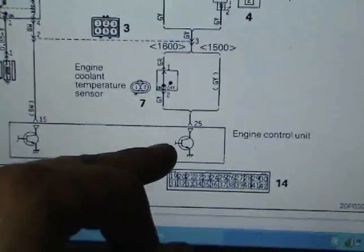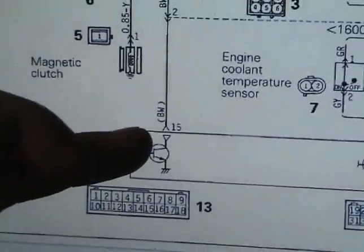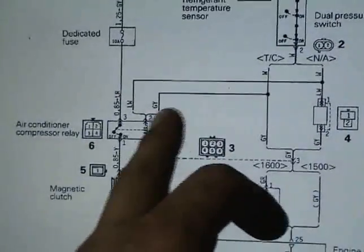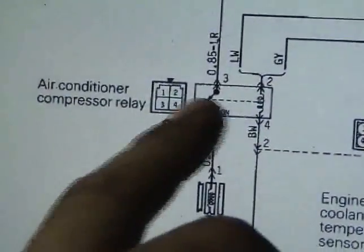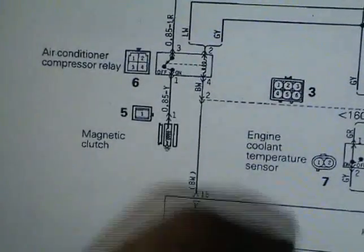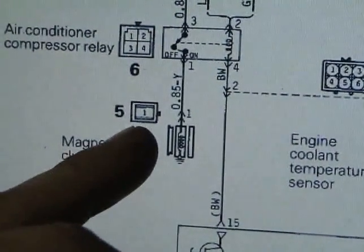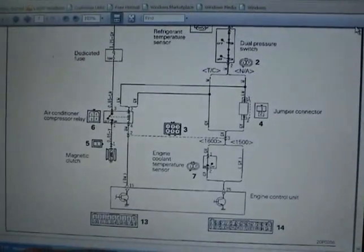After all these conditions are met, it says to the ECU, okay, we need to turn on the air conditioning. Over here on pin 15 coming out of the ECU, the black-white wire goes directly to the air conditioner compressor relay, which is also triggered by that wire to give it power. The ECU says give it power, turns the relay on, the magnetic clutch clicks on, and your AC system is functional. A good way to test the compressor before you install it: jump 12 volts to the single wire going to the clutch and you should hear a click. If you hear a click, it's good. That's an overview of the AC electronic system.